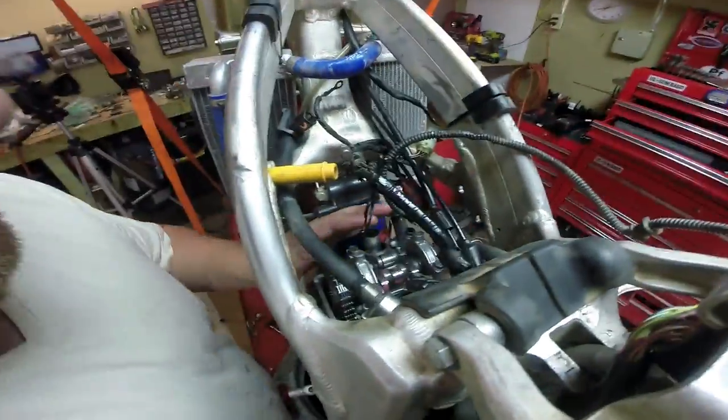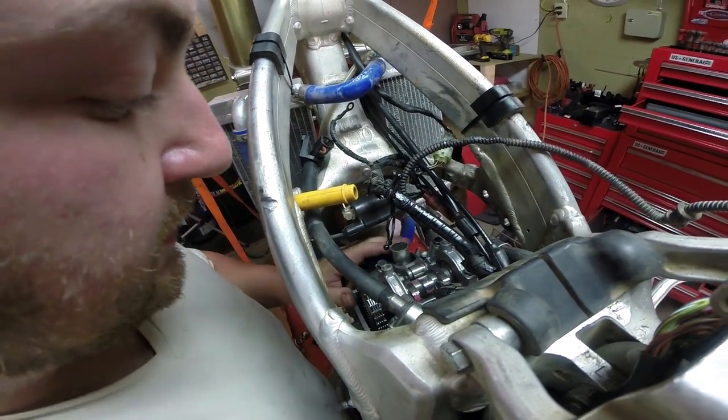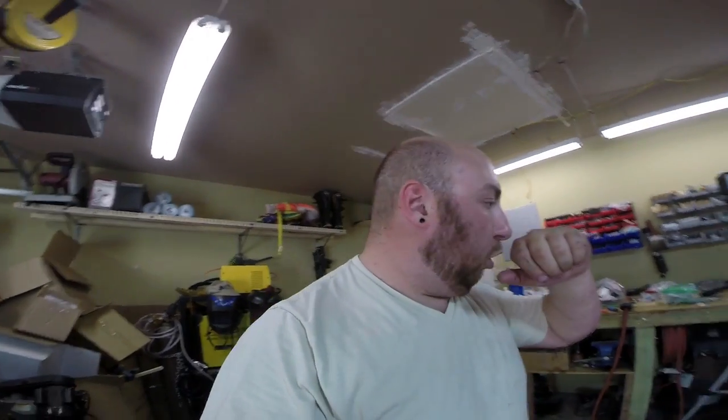You can see our timing is still set here — check on the other side, timing is still set. That's one thing I can't stress enough: check your timing. Every step I do when I'm rebuilding a motor, after I've set the timing, I check it. Put the cam retainers on — check the timing. Put the spark plug in — check the timing. Because one tooth off on the timing, you trash a brand new engine. It's not worth it. It's an easy thing to do, and the more you learn to double check it, the more you learn to trust yourself and know that you're doing a good job.